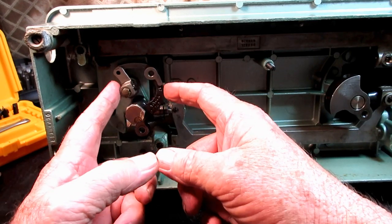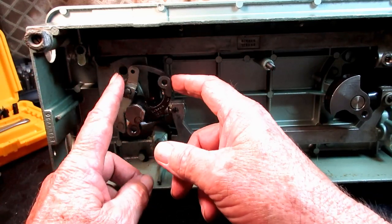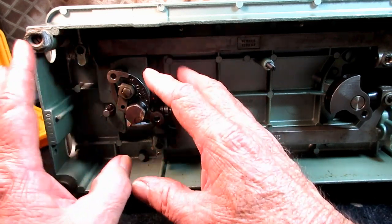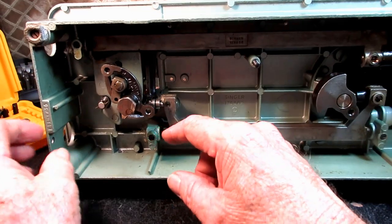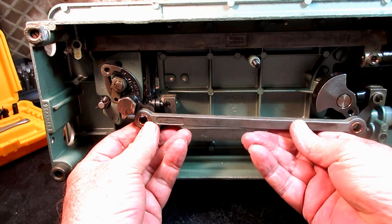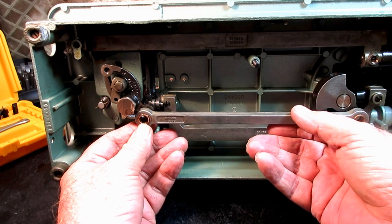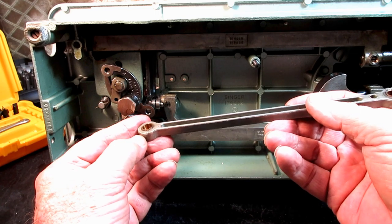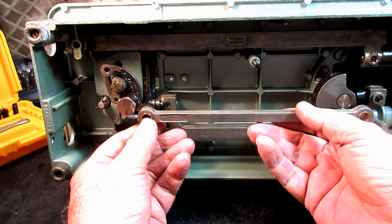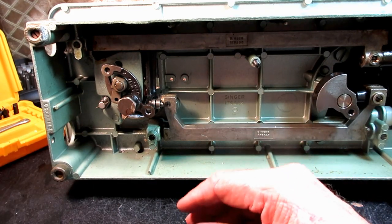And by the way, I had lubricated the machine real well before I started troubleshooting, because that can free up binding right away on an old machine. So it's not the hook crank anyway, and it was not the Pitman connection. It's really hard to get this too tight because the screw only goes in so far. But if it was not seated properly, or the screw had stripped or something, and the hinge stud was at an angle, that could bind it too. But not the case here.